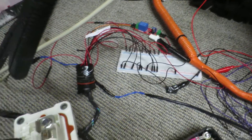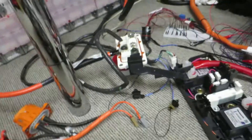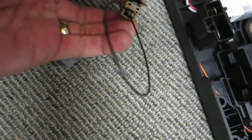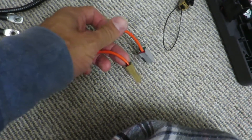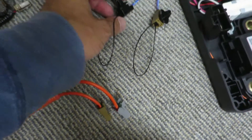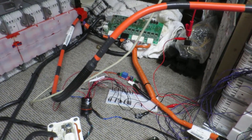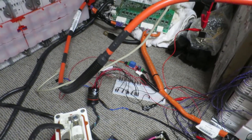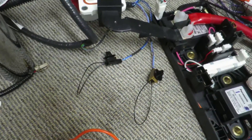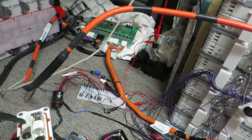I don't even have my Arduino plugged into the BMS at the moment, because it just works as it is. I've got all the relays here shown in the previous video. I've taken these two connectors out — the main high voltage and the car voltage one — and I've just put a wire in to trick the BMS into thinking that they are connected. The BMS does trigger a bit; it goes high or low when those are connected or not, so it knows they're there. So I thought the best thing to do is just loop them around as a feedback loop, and the BMS should be happy when it comes to doing charging and stuff later on.